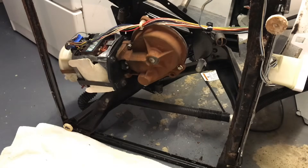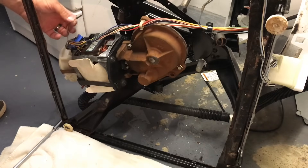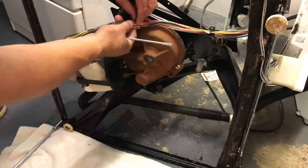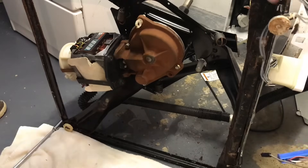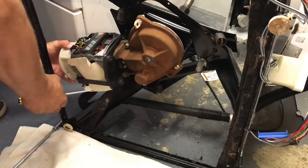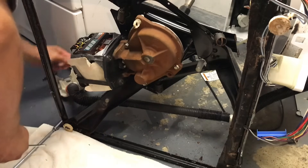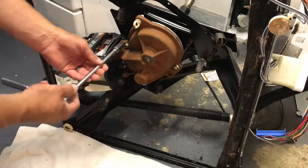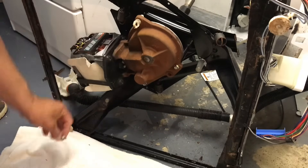With the machine laying on its right side, you're going to remove the ground wire and the wiring harness, pull the wires out of the wire holder and put them up out of the way. Next step is to release the water pump — just grab it and pull the shaft like that. Don't lose your clips.